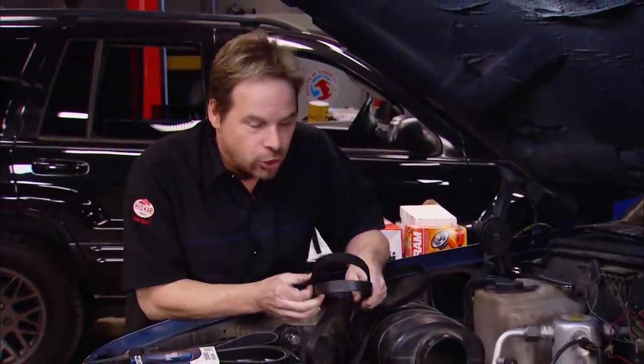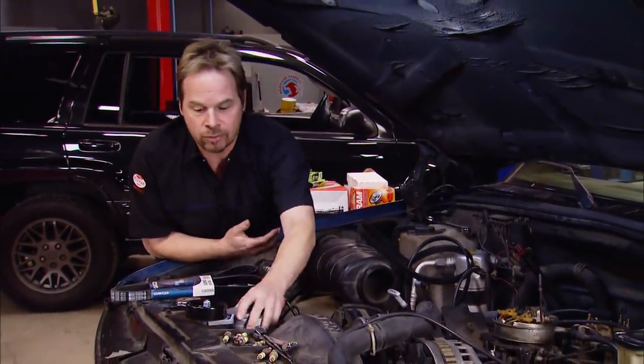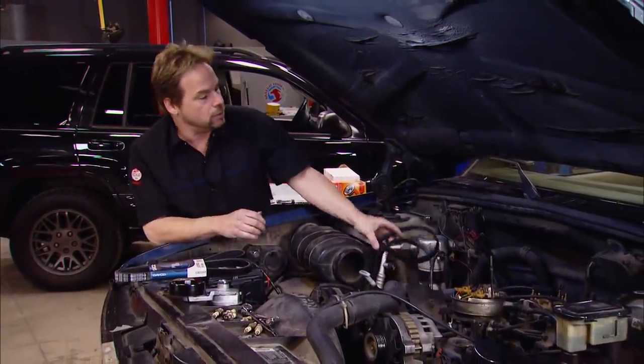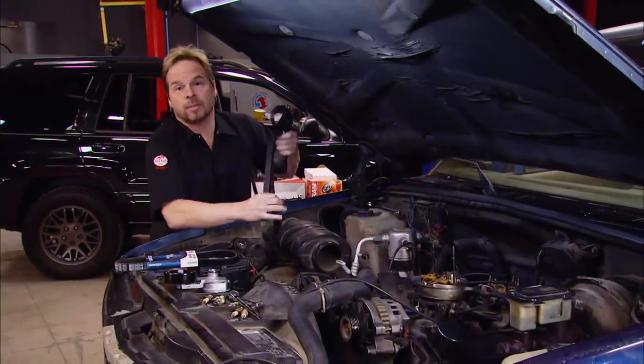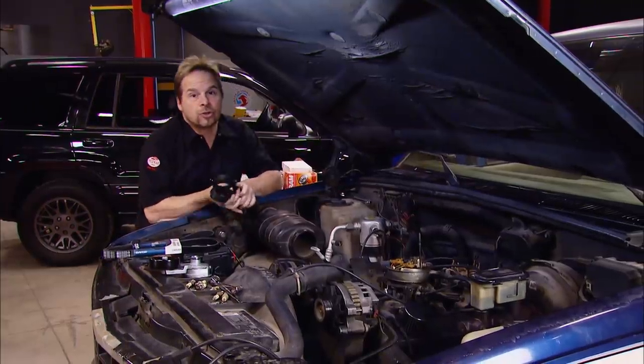The serpentine belt is just starting to show signs of wear, so in the spirit of basic maintenance, we're going to replace it. The pulley for the tensioner is a little sloppy, so we're going ahead and replacing the whole tensioner since it was available as a unit. Just like Ryan said, a spare is not a bad idea — especially with a serpentine belt, because you've got one shot if it breaks. So the old belt is going behind the seat of the truck. The next time you see this truck, it gets a lowering kit.